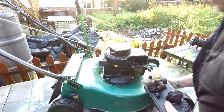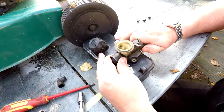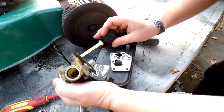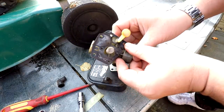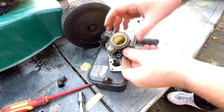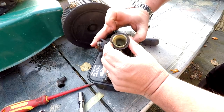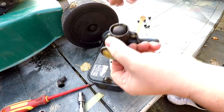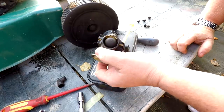Let's take this top off, just undo these screws. We gently lift this off and get that old diaphragm and gasket. Don't forget, this was all new. The filter actually looks okay — I'm surprised by that. I thought that would be blocking fuel. That means possibly this might have perished, so I might have to dig that out and see if it's broken.